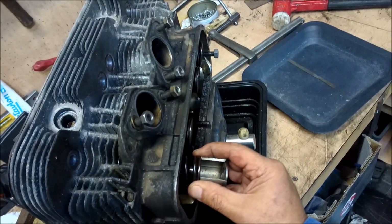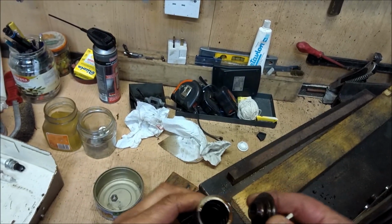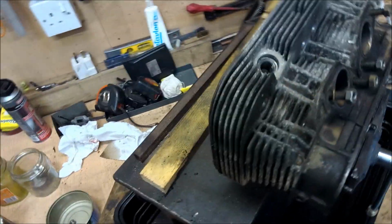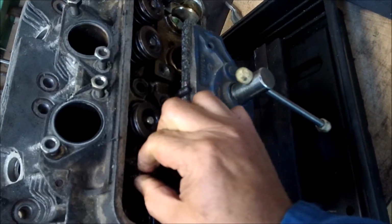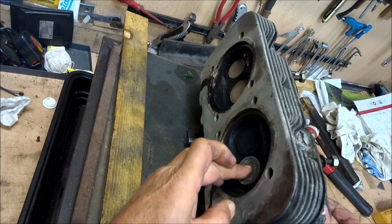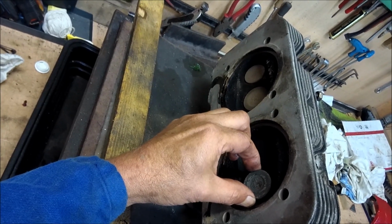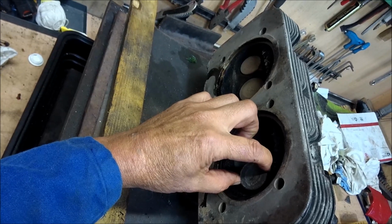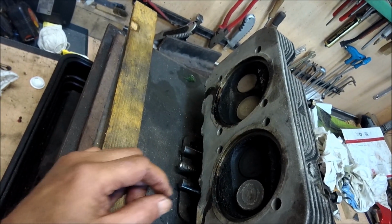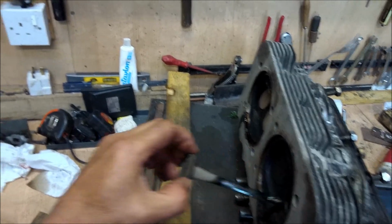Yes, right. So, off comes the valve spring. Okay, keep that to the top. And then we can have a look at the valve. See, there's the valve. Now then. Here's the valve. Oh look, see the play? Look, not so much in that sense. Well, yes, even more in that sense. That is not acceptable. You see? Okay, this valve is going to be changed anyway, because it's the exhaust valve.